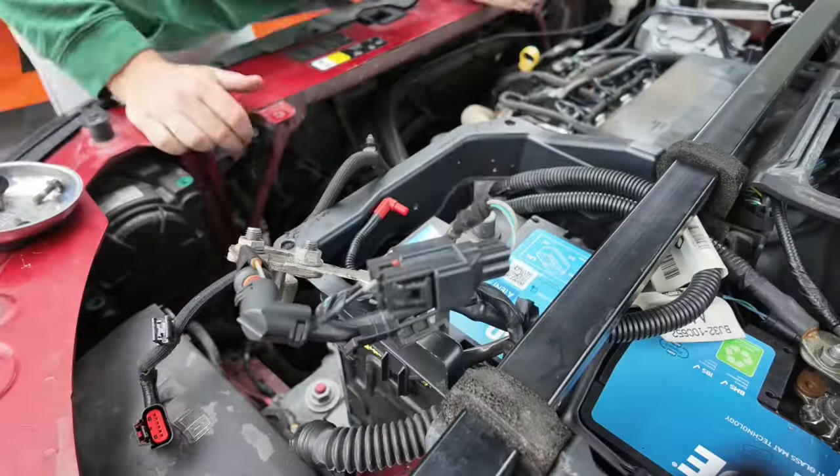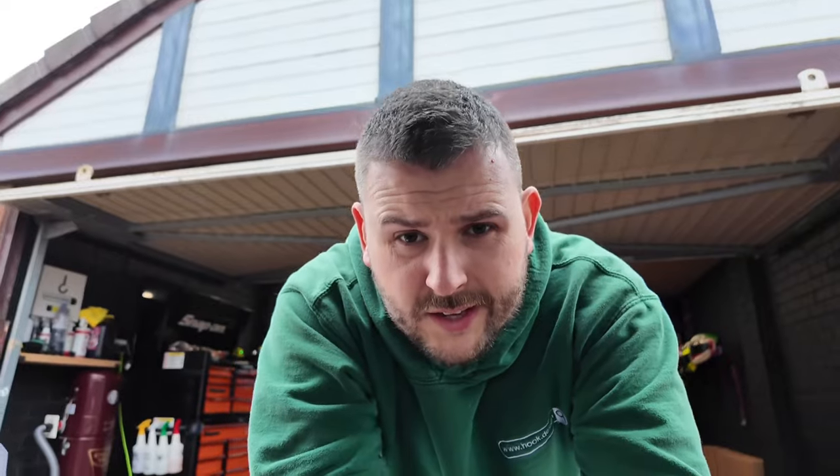So it's my Saturday. I'm going to disconnect the battery now, because there's a power lead going to that starter motor and I don't fancy it sparking. There are other common factors that can cause this too: the earth cable from the battery to the body — make sure that's clean, and make sure there are no broken wires going to the starter motor. Earth cable: taken off, cleaned up, done that prior to today just to see if it was an easy fix.